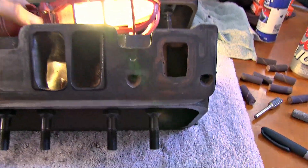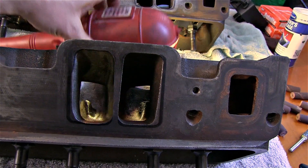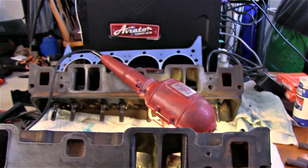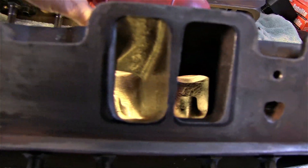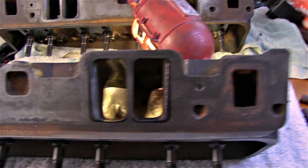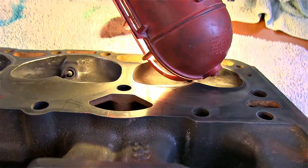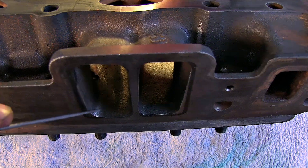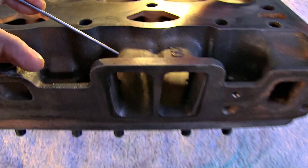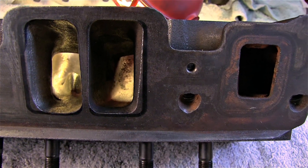I've got the head flipped upside down to get a better view with the light. On the push rod side, you can only go so far toward the gasket line before it starts breaking through. I've actually broken through one of these heads before — that's how I know the limit — but I fixed that with some welding. The Vortec heads do have raised runners, but only up to a point, and they have this little ski jump thing at the roof.